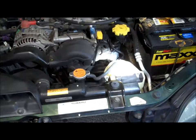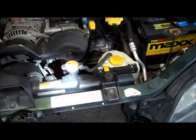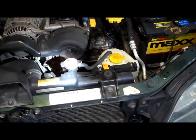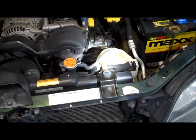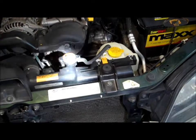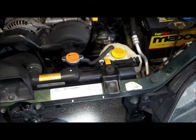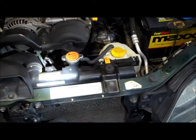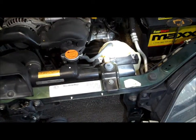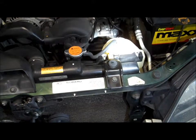Radiator. Now we're concentrating on the coolant system — your radiator. You need to be careful with this system because it's going to be under pressure. Hopefully most of the time you're just dealing with the reservoir, but if that reservoir is ever empty, especially once the car has cooled down, you'll need to add directly to the radiator itself. At that point you might want to take your vehicle in for a radiator flush, because you can get serious damage if you run it too low. If you're out on the highway and this is empty after the car cools down, add to the reservoir first, then to the radiator.